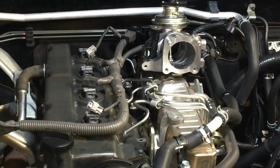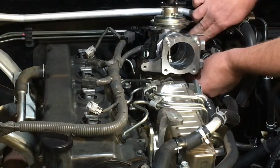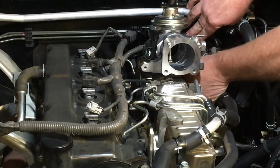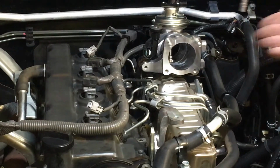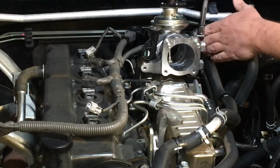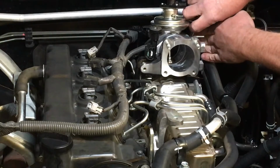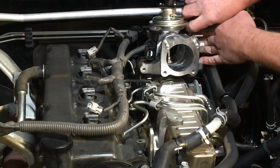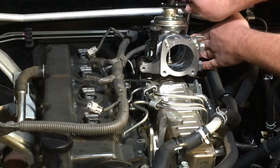We could have got the grease, but whatever. So I'm going to put a bolt in down at this side. Look, you've got the wiring loom there. It's a bit fiddly to get in place, but you get that. So get your long extension. And you remember the wobbly socket, right? Single hex is best. And if that's all just sitting in place nicely, push back on that wiring loom, that's the easiest way to get it started. If it's not starting, it's probably not sitting in place, so give it a jiggle, and then it should.